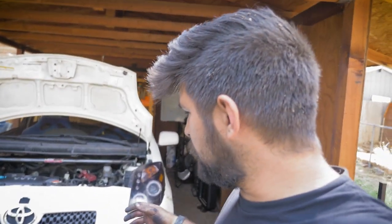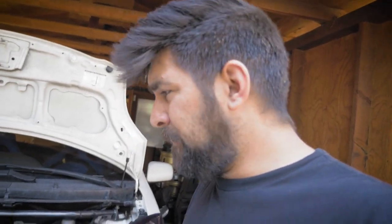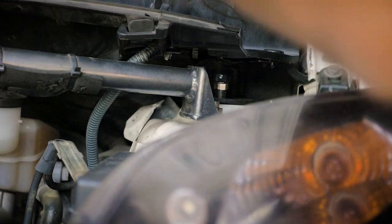A little bit of good news, bad news. Good news is I don't need to change the steering rack bushings because they're fine. Bad news is — where are my steering problems coming from if it's not the steering rack bushing? What's happening is if I jerk the wheel hard to the left and then put it center, the wheel centers. But if I jerk the wheel hard to the right and then put it center, it's slightly off. So something is squishing somewhere in this process. I thought it was the steering rack bushing shifting from left to right, but it turns out it's not. We'll solve the steering problems later.